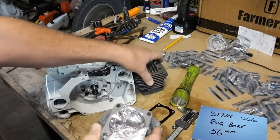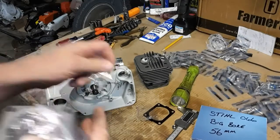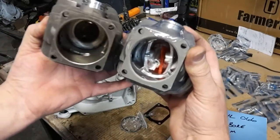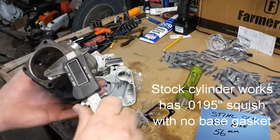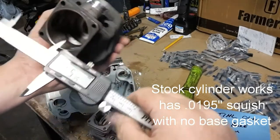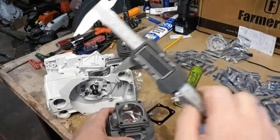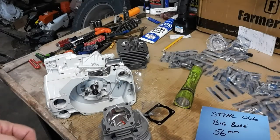You can kind of see the difference. Since I'm going to be using this one, let me go ahead and open it up — at least I hope I'm going to use this one. I hope it's not another issue. You can see the difference in the bores. I'll just do a fast comparison here with my caliper. This is the big bore: 55.35 millimeters, so about 55 and a half. That one there is 53.32 — so that's 53 and a half. So you're two millimeters bigger.